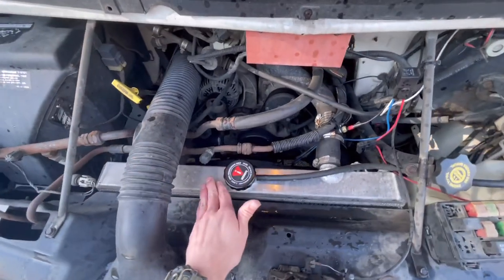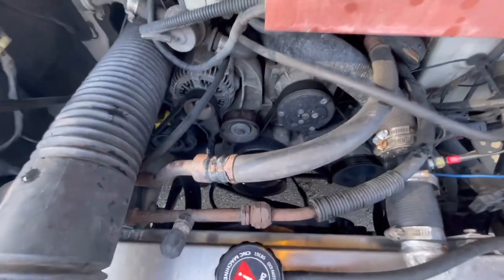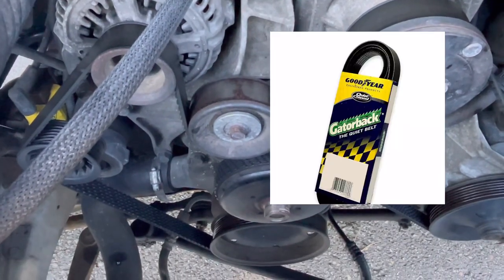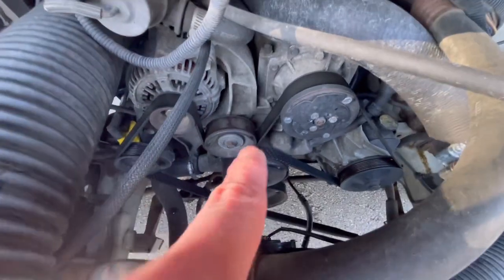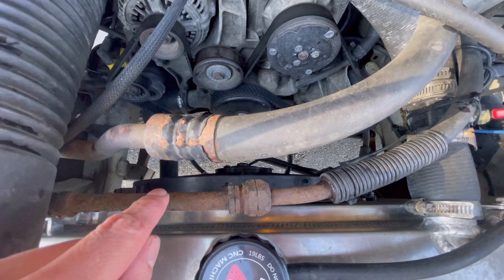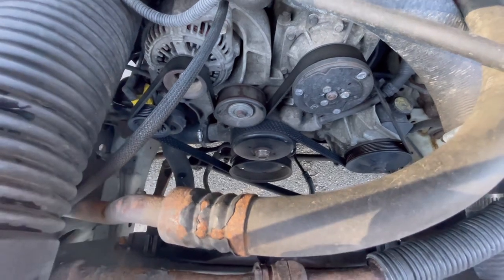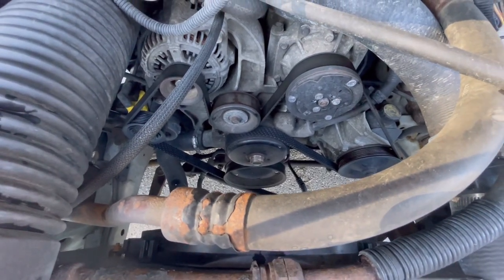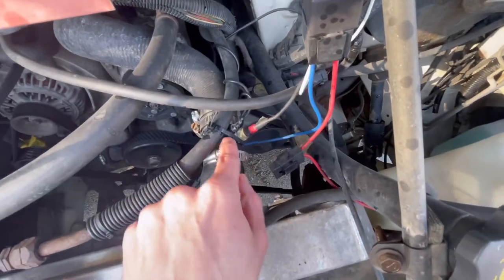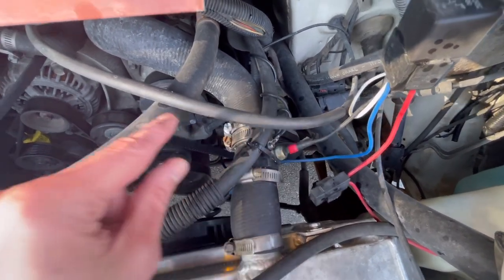The radiator is a three-core aluminum radiator with an electric fan that I added. I recommend getting the Gator belt for the 5.2 and 5.9 Magnum — it also helps with overheating if you have a mechanical fan. Someone in my previous comments recommended this electric fan, but it only puts out about 3,000 CFM; a mechanical fan puts out much more. I'm thinking I'll put that back on for the summer. I have new radiator hoses, here's the adapter for the e-fan, and here is the electric thermostat/fan switch.